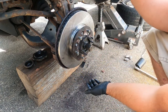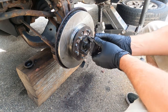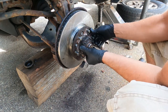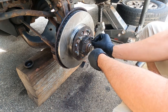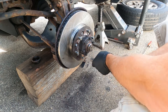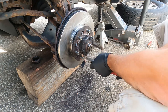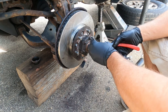After you're done, you can just give the wheel a shake and see if there's any play. If there's still a lot of play, you might have to tighten that nut up a little bit more. Now we can put this hub cover on and put all the nuts on — we can snug these down. And take your lock ring.